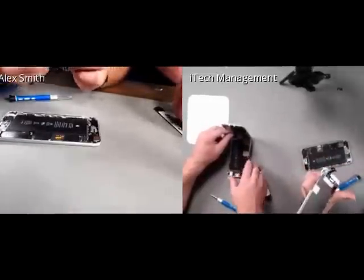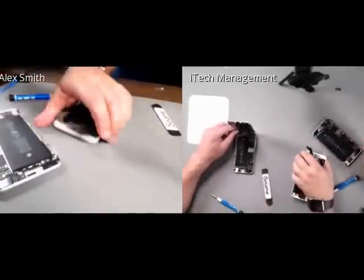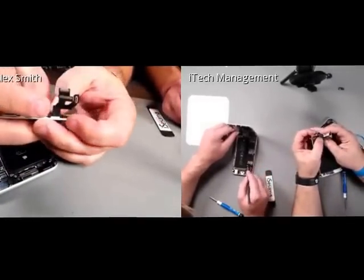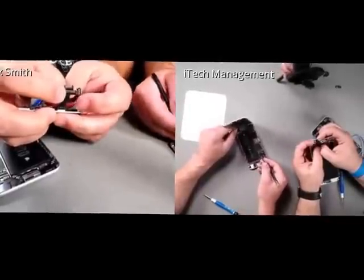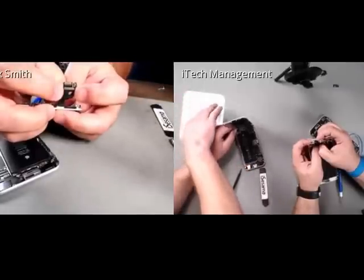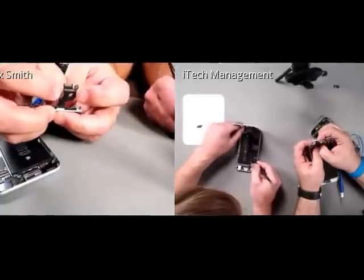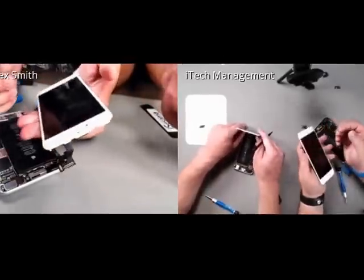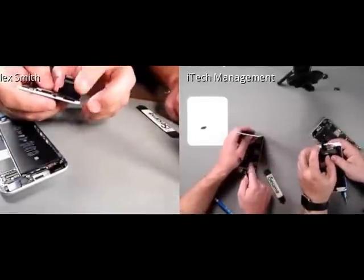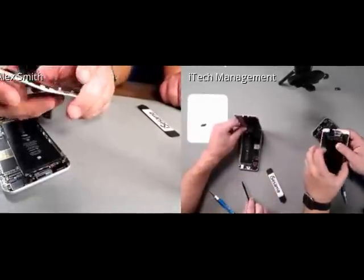And I am going to be disconnecting the battery of the iPhone 6S when I get a spudger. So one of the things I notice here, unlike the 6, on the LCD digitizer flex cables, they've now reinforced the cable, so we won't have the issue with these like we did on the 6 and the 6 Plus, where the digitizer flex was extremely weak and could easily bend or bow on you, which is typically what happens when you get the boxes and lines across the screen, because that very first cable had slightly gotten bent or bowed when you were connecting or disconnecting.